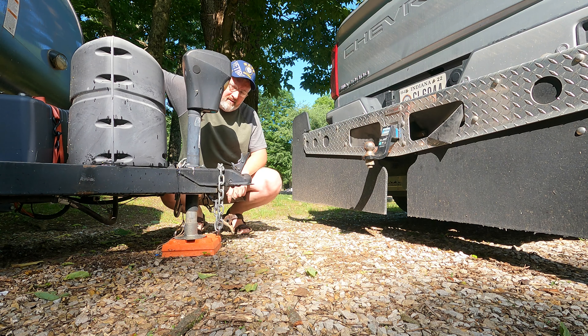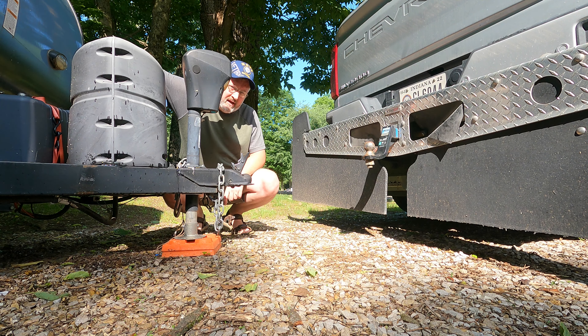Go ahead and isolate the propane tank while we're here. When you bring your propane tank online, open the valve slowly initially — it tends to slam the check diaphragm and that can cause all sorts of problems with propane flow.